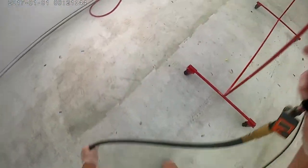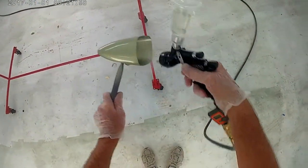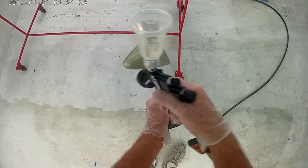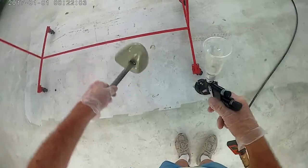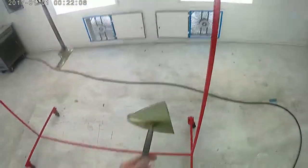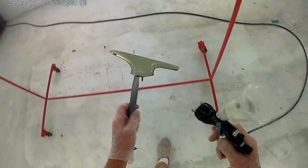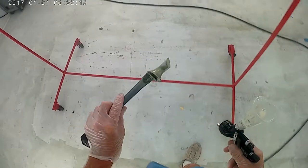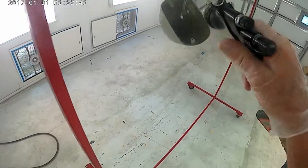I'm putting on the second coat of clear. On this coat I will get inside the mirror cavities, which is the part that sits behind the actual glass or mirror itself. You've got to be careful not to put too much clear on — just enough to get it shiny, that's it. Not enough and you'll get dry spots; too much and you'll get runs.